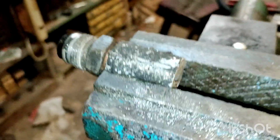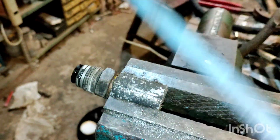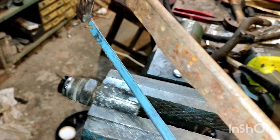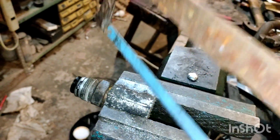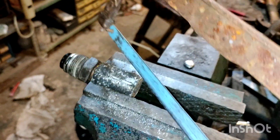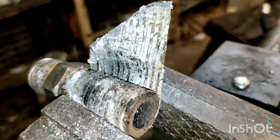So what I do is I put it in a vise, I take the hacksaw and I cut it like this. Now, you might need to chisel it off at the end if it doesn't get the little burr, but you do not want to push this too hard. You just want to get it enough to get this metal piece off, because the only thing separating the metal piece from what you're actually trying to save is a little tiny piece of rubber, and if you cut through that, you're doomed. So let's do that. Alright, and I have that peeled off.